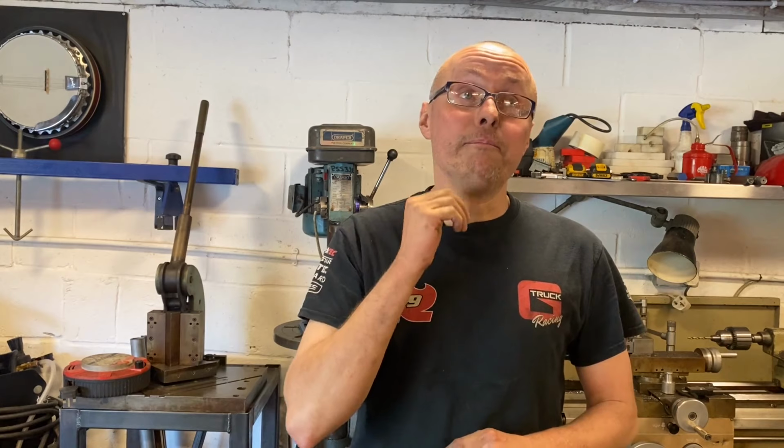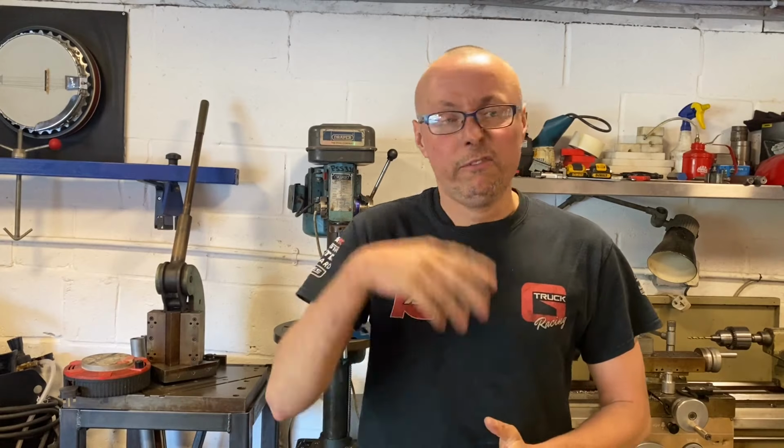A few reasons. Obviously the back end, you just had some pistons. So there's the old theory of breaking an engine in, which is true but not true. Basically what you're doing is making sure the piston rings are sealed to the bores. That's the main thing we're doing. Normally you do it on a dyno, which is what we've done before, over a couple of hours or so, various loads, but we haven't got the luxury and obviously we're short on time.